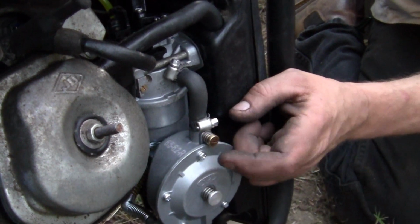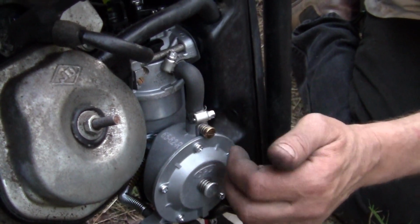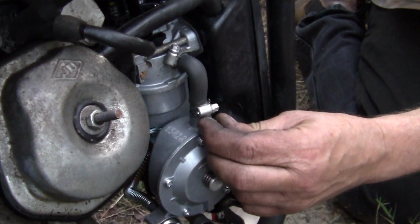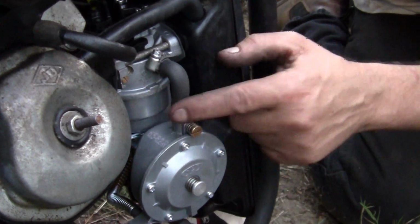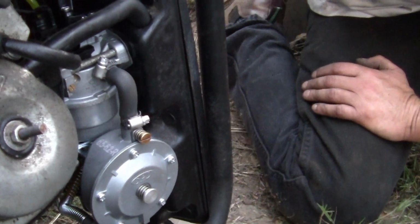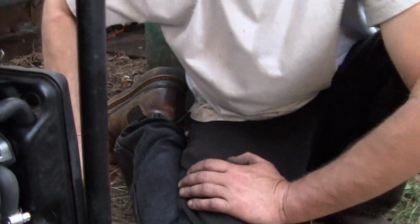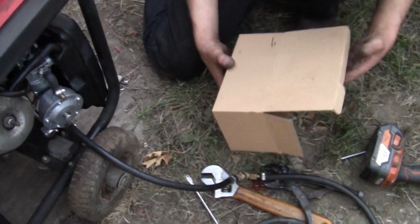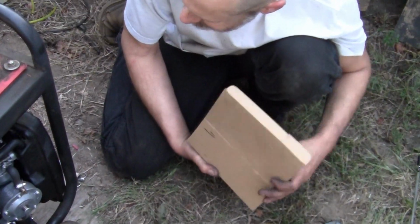I am going to make one of these too. And I'm going to make it with a knob, like a knurled knob, to where you can adjust, because this is for your load. And not all of us have a screwdriver. I'm also going to put a heavier spring to where it doesn't move under vibration. Would I buy the carburetor? You betcha. I'll leave a link below. It comes in a little box like this, and I do believe you can get this for a pretty reasonable price.